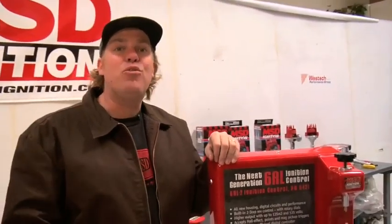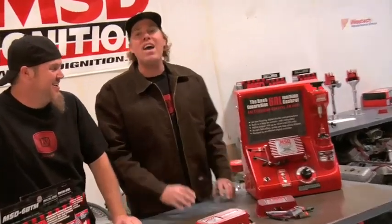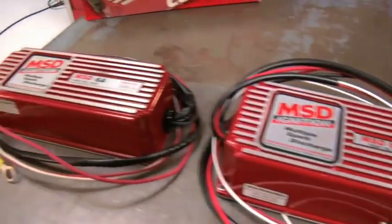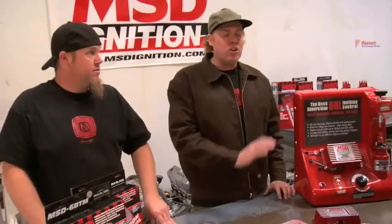The MSD actually delivers 500 volts to the coil as opposed to 12 to 14 in a stock vehicle. That gives you an idea why you're going to want to select an ignition system. MSD makes a ton of products to improve ignition, from the entry level 5 series to the full race 7 series. But what we're going to talk about today is the basic 6 series CD MSD ignition systems that you find on muscle cars everywhere.